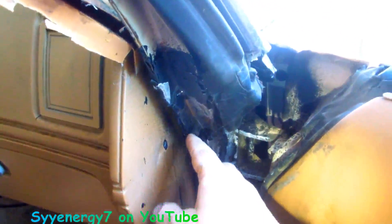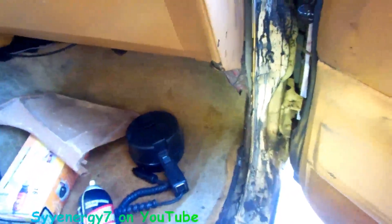I had to put a little patch panel up in here because this was rusted out. I still got to do another one right up in here. I got the metal, just got to shape it to go from here to here. I put it in there, made that angle, came around and curved down this way. It's in there. I just got to sand it down a little bit. You notice this plastic piece goes over and you'll just be painting it this color right here, which isn't going to take too long. It takes more time for the stuff to dry than it does to actually do the work.